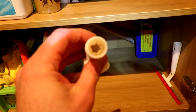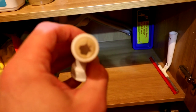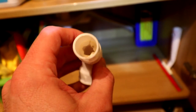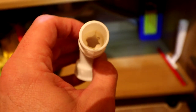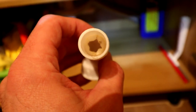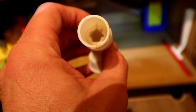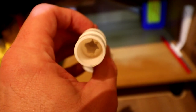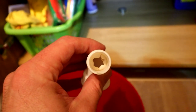So this was interesting — I've emptied it but you can see there are a lot of what look like pieces of plastic that haven't been machined off properly. You can see there's no chance for food to get through without getting caught up on that. It's like the plastic tubing hasn't been machined properly. I'm going to strip all those off with a screwdriver or a long knife. That's probably what actually caused it — bits do get past the filter and are supposed to exit through the drain, but with that narrowing, over time it caught some bits. It wasn't a lot actually — a couple of bits of peanuts, a bit of fluff — all caught on there, and that's what jammed it.